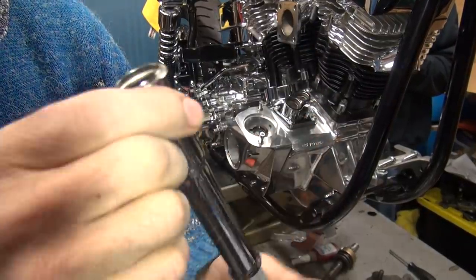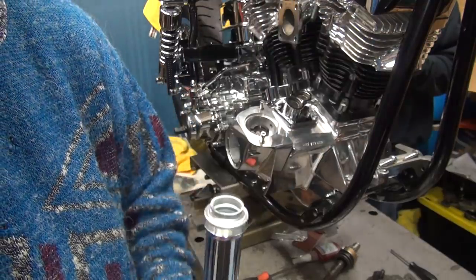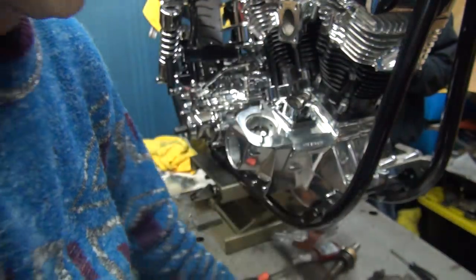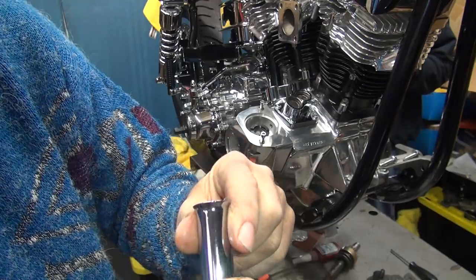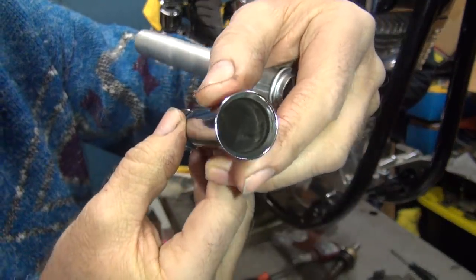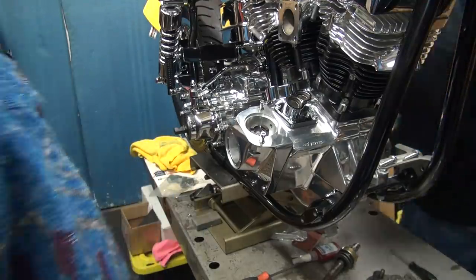Okay, now this here, we had to work on these a little bit. See, these are no longer binding up like they were. So they have a nice internally honed area here now. See, they can't even hone their bearings correctly, so honing their push rod cover is probably out of the question for them to do. So you see how that one's uneven inside there. All right, so now your push rod covers actually fit. Are you happy now? I am, sir. Thank you.